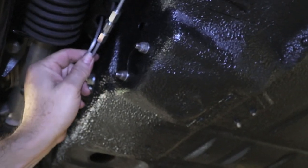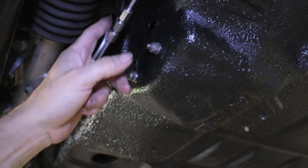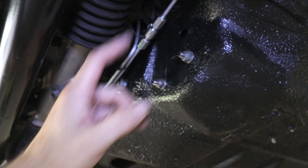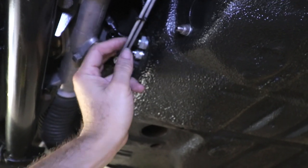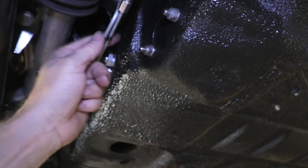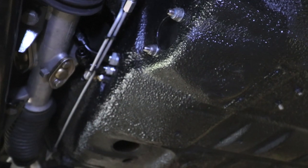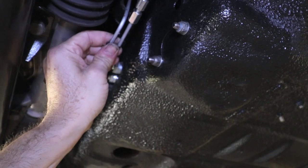Under the car now and you can see a mess of brake lines here. This is where the pedal box is. The master cylinders have their outlets right here, then this one goes to the rear of the car and this one gets teed off - one to the right wheel and one to the left wheel. Previously I had put some zip ties around these brake lines to keep them separated and prevent them from rubbing together. The issue though is these two, if they bounce around and are touching, and if they were to wear a hole in each other, then you would lose brakes - so that's not good. I'm gonna put those spacers in today to keep them separated a little bit better so they don't ever touch.